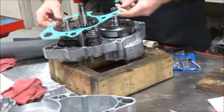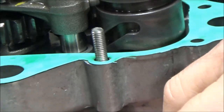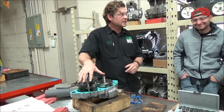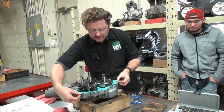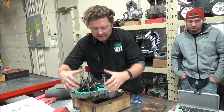Now let's do a test fit — we don't have any protrusion in there, and that is how you fix it. In summary, we're talking about these little attention-to-details that make everything better. In this case, if that gasket material is hanging over when you tighten things down, there's a chance it's going to lift the gasket because it's being pinched.